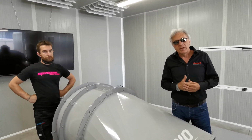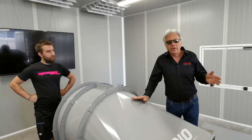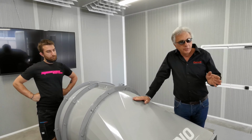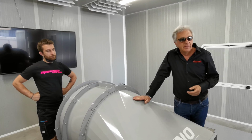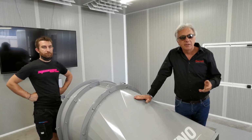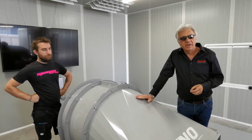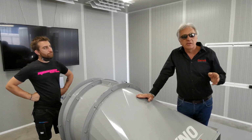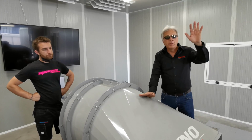So we start from the Garrett 1446 for the low performance. I mean, low is 200 to 220 horsepower. We move to the Mitsubishi TD04L for 230 horsepower, and the Mitsubishi TD04HL for 290, more or less. And up we will move with the Garrett Performance GT2860, GT2867.